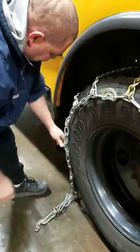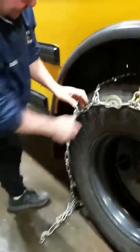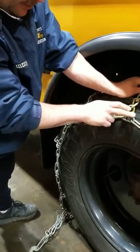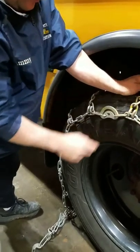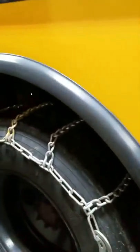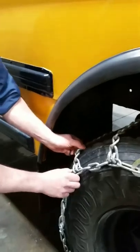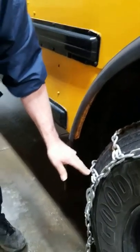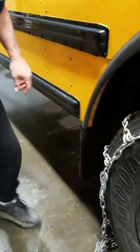While we're here, I'm going to adjust this chain so it's got one cross-link between the knuckle-link and the top of the tire — one on each side all the way around. It doesn't have to be perfect, but that is a good guide to help you keep your chain straight.